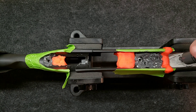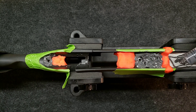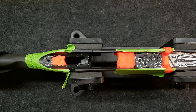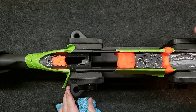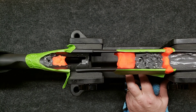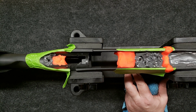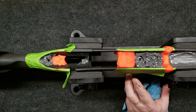Now with what I've got left here, I'm just going to kind of get it up here in the front area. The reason why I'm skim coating this here is this concrete is not waterproof. So my thought process was we'll just use this JB Weld to give us the waterproofness. So it's just a very light skim coat — I'm not adding any depth to this at all, or at least trying not to.